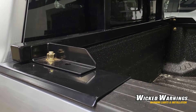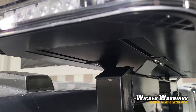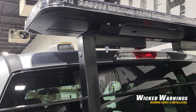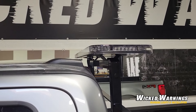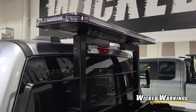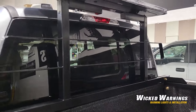Let me show you a little bit on the back rack. It's a standard back rack for a Super Duty, but what we did is we clipped the ears down and were able to use the Phoenix rack mount base for that light bar after we clipped those ears down. Clip the ears down, touch it up, put it back on there, put the plastic plug back in — and that way you can shorten up that headache rack just a touch. You can see here how the light bar is mounted and it casts over the roof of the truck just fine. It's not being blocked, it's at the right height. We ran all the wiring for the light bar right down the other side, tucked it behind the rack really nicely, and ran it up the passenger side to the front where it connects to the auxiliary switches.